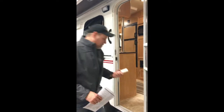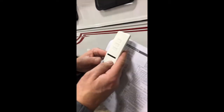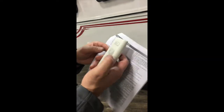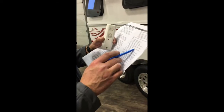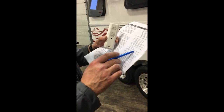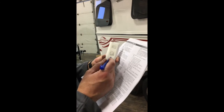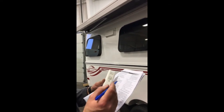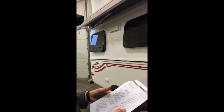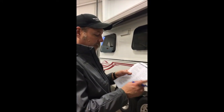Got the remote. On some of them — this is the older remote — some of the newer ones where the black stripe is in the middle, you actually have to pop the rear cover off to get to the reset button. But on this one, here's the key: push and hold the button. It'll jog twice. Wait six seconds, then it jogs again. You have to hold the button in for that extra six seconds — don't let go of the button. I'm going to push it in, holding it in. It's jogged. Holding it in still... there it goes. So now we're in setup mode. It's number three that stumps most people — you've got to hold that button in for that extra six seconds for the second jog.